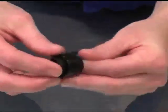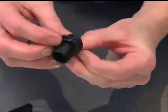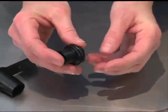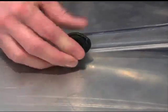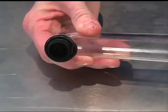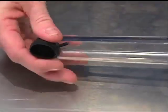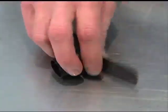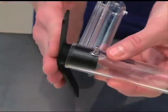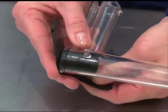Turn the outer part of the black nozzle tip inside out. Insert it into the opening on the upper part of the pump, making sure the tab is pointed toward the dome. Then flip the edge up. Push the black inlet valve into the opening on the lower part of the pump. Fasten the valve by hooking the two flaps onto the pegs.